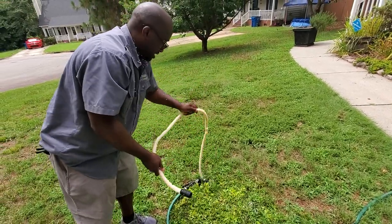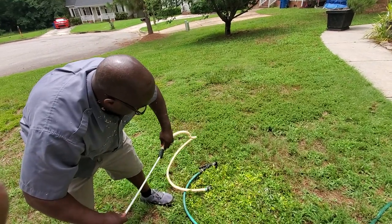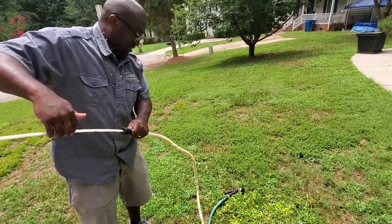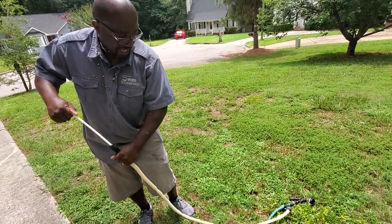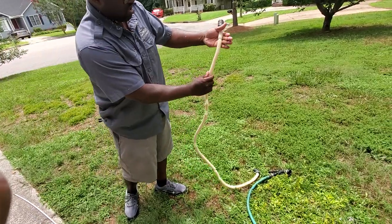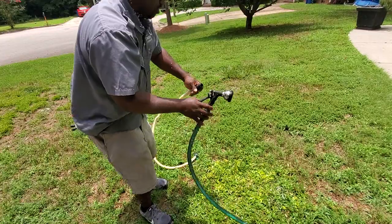How I know this was bad — I actually took the dishwasher out from under the sink and turned the drain pump on. The drain pump was actually turning, so I knew the drain pump was good. And then I noticed I couldn't get any water coming out of these drain lines. If you look at them, you can just see all the white stuff filled up in them — it just comes from using too much detergent.